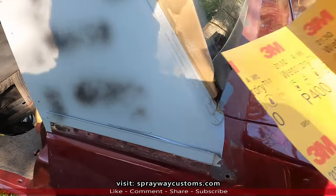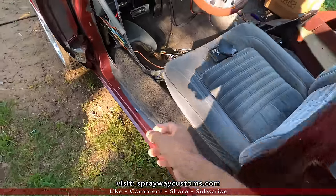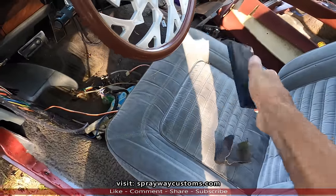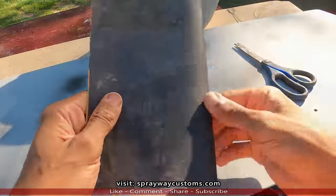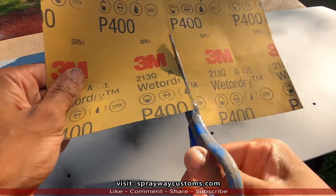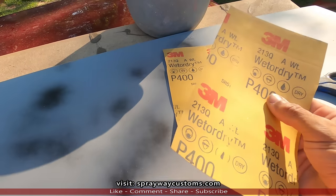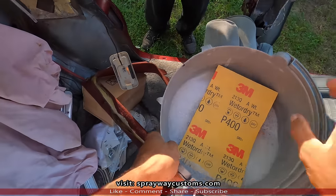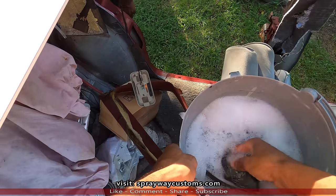About to wet sand it with 400 grit. Got a rigid block. I'm gonna be using this rigid block here. Got my 400, I'm gonna fold it in half and cut half of it so I can put it around my block. I'm gonna let it soak for a minute or two in my soapy water. You can see, I put my block in it as well.